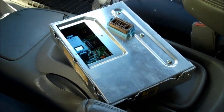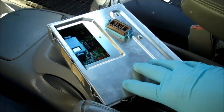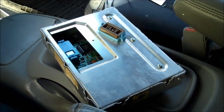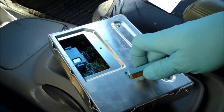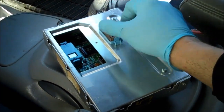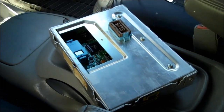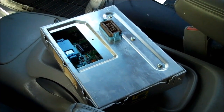If you want to take it to the next level and don't mind spending a little more money, you can start by tuning the truck. What I like about an electronically controlled vehicle like this — and that's why I really like the 94 and 95 years of the 6.5 liter diesel — is that those were the OBD1 control units and they came with removable chips from the computer itself. This is the computer that sits in my truck. I've got three different chips with different downloads depending on what I'm doing: one for miles per gallon, one for towing, and one just for overall power. The best place I've found for tuning chips is Heath Diesel — this guy lives and breathes 6.5 liter diesels, but he's not the only one out there. The 6.5 liter diesel is still thriving in the aftermarket world.